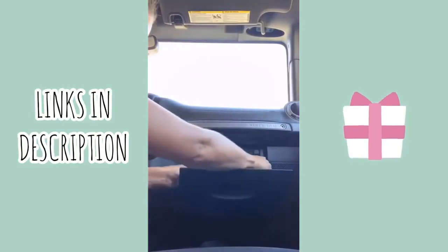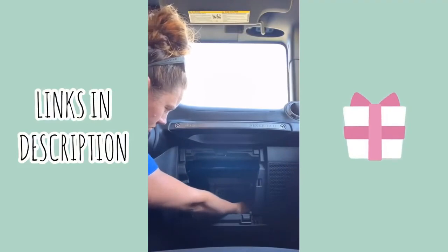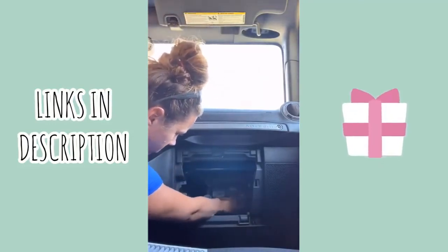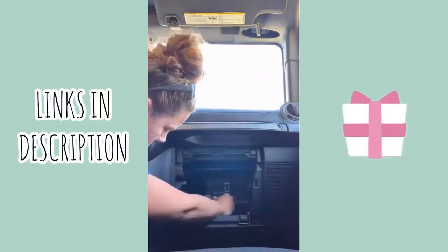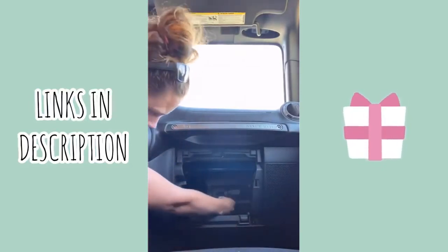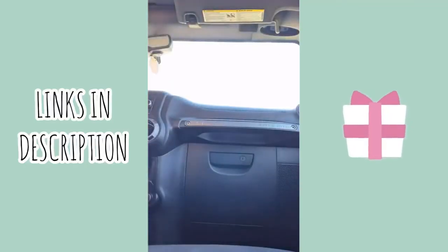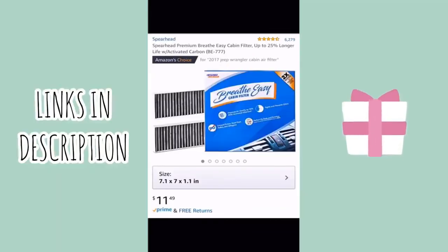To make your car smell good, I researched where the cabin filter was in my Jeep — it's located inside the glove box. I took the glove box out and found the two cabin filters; my car didn't actually have them, so I ordered them off Amazon. They came in a two-pack and were super easy to put in. I tore the air freshener in half because it seemed super strong, put it in there, put the glove box back, and everything was good. It's still super strong so I might tear it into a quarter instead. It's only $3.74 on Amazon, and if you're a Jeep owner you'll also need that cabin filter.